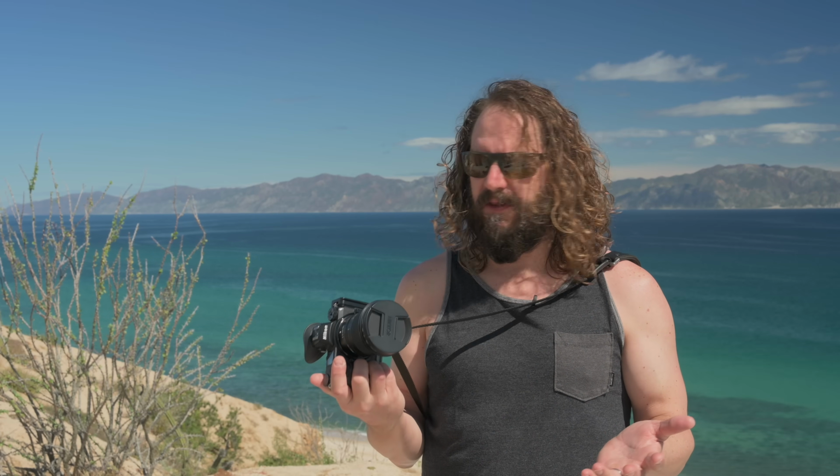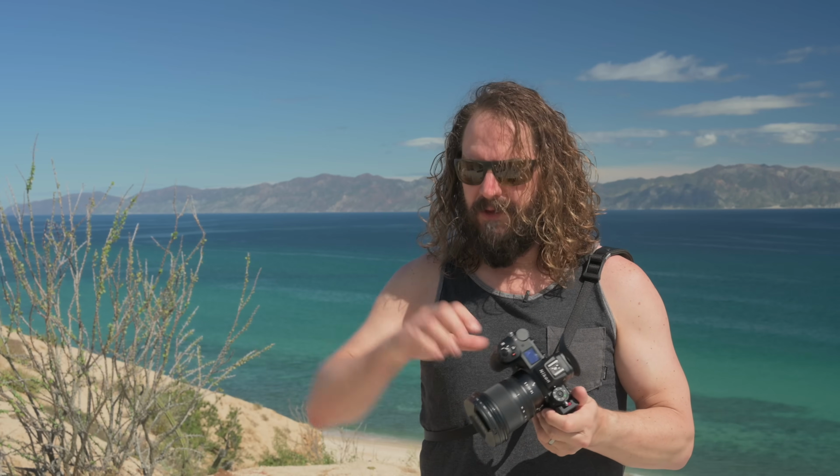If you have to do wet sensor cleaning on your mirrorless camera, it's actually a whole lot easier than it was in the days of the DSLR. You don't have to open the mirror, lock it up in place, reach way in there to do the wet sensor swab cleaning. Now, for those of you using some of the fancy cameras that have moving sensors that sort of do in-camera, multi-row panoramic capture and that kind of thing, you want to be a little bit careful. You want to read your user manual before you go wet swabbing your sensor.